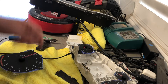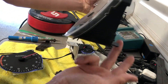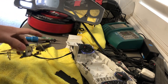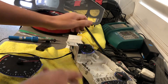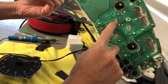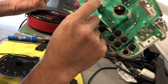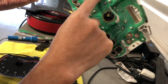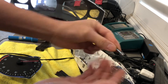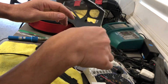I just pulled this apart — it's pretty straightforward. Open up all the clips around here. You end up with 8 clips in the back. Push them in, pull it out. Pretty easy and straightforward. For the cluster, there are 3 screws behind here — one there, two and three. Be careful when you lift this up because you might tear the plastic circuit board and you will have a bad day. Once you open those three screws, which are these long Phillips, this will automatically just fall right out of the cluster itself.